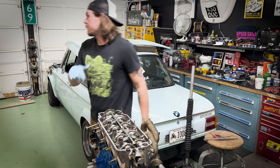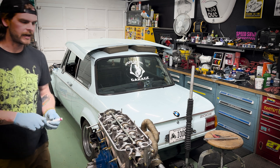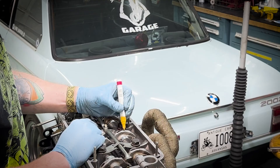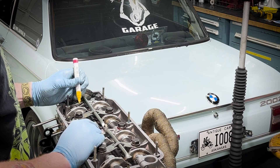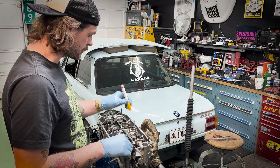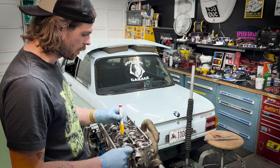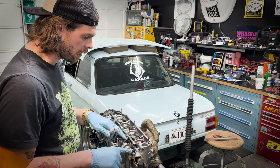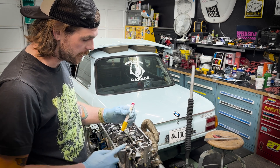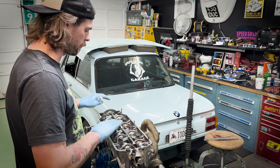I'm going to get my little magic yellow marker so I don't forget which ones I've done. I'll probably just go through and double check everything again just in case. I've been marking everything except for my head bolts, because these are going to get re-torqued after they get hot. I don't want extra lines - the plan is to get it all warm, re-torque them, then mark where they're at with witness marks so in the future if they loosen up I can spot it easily.